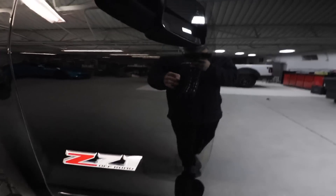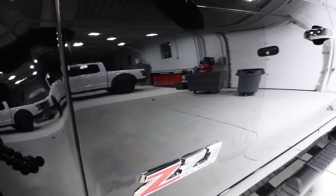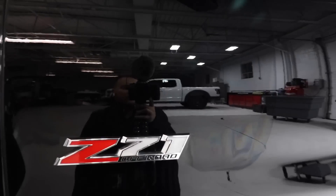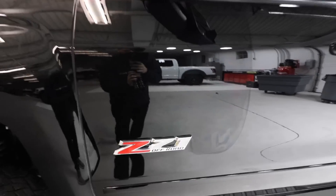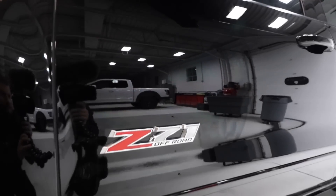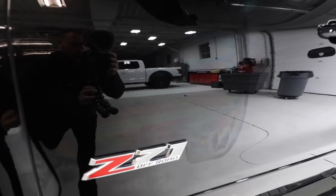You can see the coating is flashing right now - it's turned to kind of an oil slick color. You can see where I stopped a section there and kind of crosshatched. We're going to let that sit for about 30 to 40 seconds, it'll flash over, and then we remove it. If you don't remove this excess, you'll see an oil slick streaking on the paint permanently. The only way to fix it if you let it dry and cure is to polish off the whole panel. We're doing it in sections, finishing this side, moving to the other side, then the roof, and coming back to do a second coat.